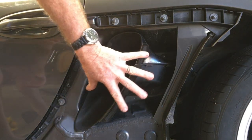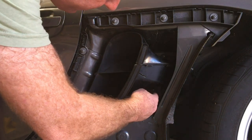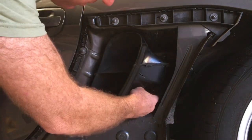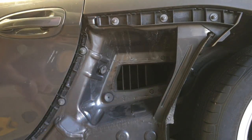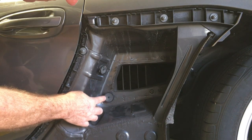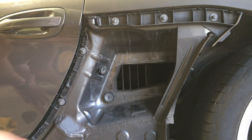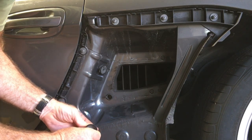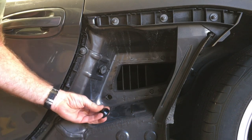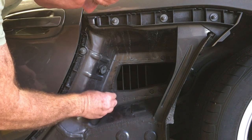After you remove the door entry guard, this is what you'll see - this is the intake here. There are two nuts that can be removed using 10mm sockets. Remove those and the intake just pops straight out. That's where the two valves are at the bottom of the two drain holes - this one here is the one underneath the big bucket under the motor, and this is the one that's in the forward seal. These can just unscrew out and they have a little flapper valve of rubber that holds gunk in place but stops bugs from getting in.